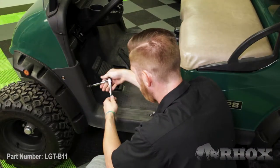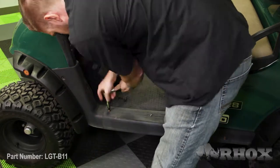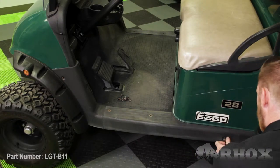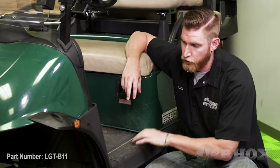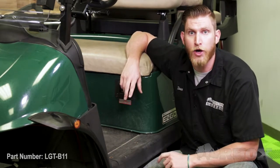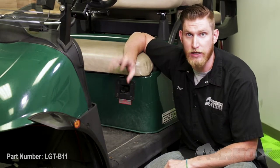The first step in our install process is to gain access to the pedal group compartment. To do that, we're going to remove our rocker panels and trim panels on the driver side of the cart. Now, typically we would remove those all the way, but since we have fender flares installed on the cart, we're just going to loosen all of the hardware up and we'll still be able to remove the mat that way. With the hardware removed from our trim panels on the side, we can go ahead and remove the plastic rivets that hold the floor mat in place. Once those rivets are out, we can fold back our floor mat, gaining access to the pedal compartment.